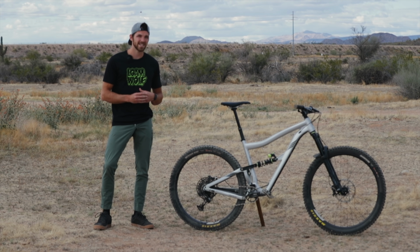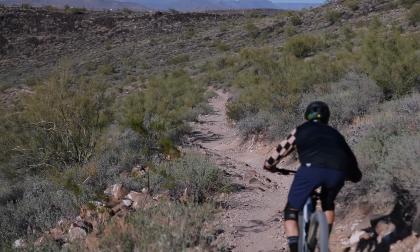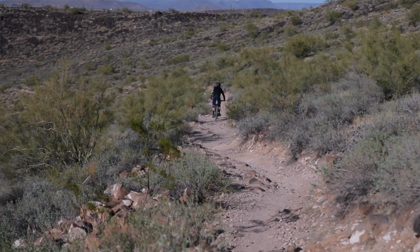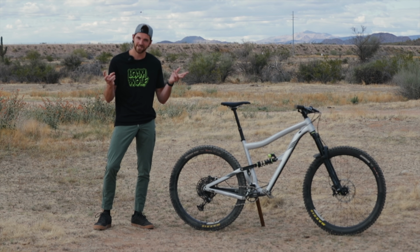One thing that really sets DVO apart is the OTT system they used for that first inch of travel. Now, what this allows you to do is dial in your sag and your compression, and then fine tune that first little bit of travel to get it supple, OTT, off the top.